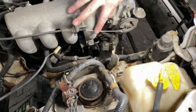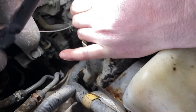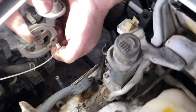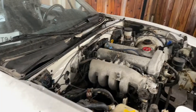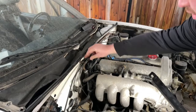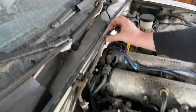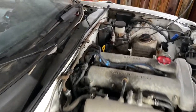Next we'll disconnect the throttle cable and then the fuel feed and return lines here on the side of the engine. You index the throttle plate to wide open throttle and then twist the cable to the open slot location and slide the cable out under the two 10 millimeter bolts from the intake manifold. The throttle cable is flopped to the side — I'm going to reroute it a little better out of our way. There are just a couple of little clips that it sits in on the brake booster pipe, so I'll pop those off and swing the whole throttle cable back to the driver's side to get it completely out of the way.